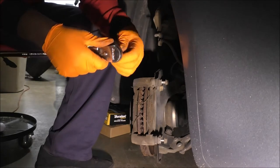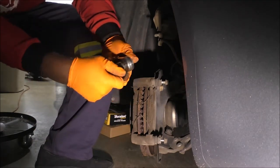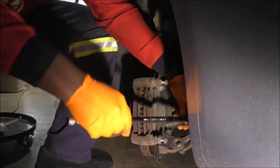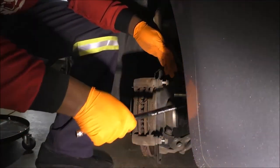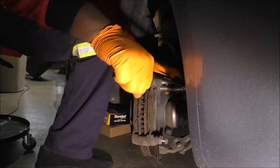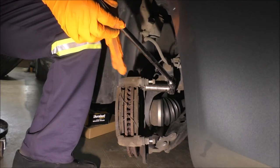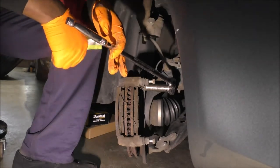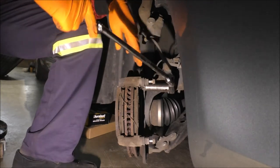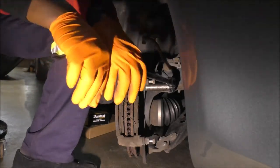I use a breaker bar, or more accurately, it is a breaker bar, but it ratchets, right? And it also swivels, it's in one axis, but still, I'll take that. Make sure it's in the breaking loose, loosening direction. Once again, I do not 100% know the torque value to install them to. You should use a torque wrench on the way back in, by the way, but working on cars over a long time, I've gotten my wrist pretty well calibrated to torque values, and it also involves a little bit of math and some assumptions. Assumptions are always big in engineering, and there's always a feel. How much force did it take me to unfasten something? So I'll estimate the same amount of force.